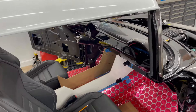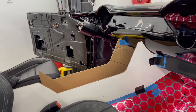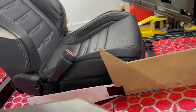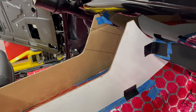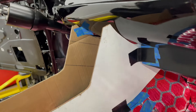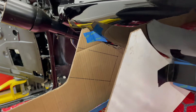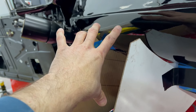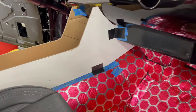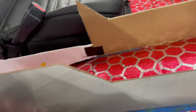Working on the console and getting templates together — started with cardboard and a piece of plastic. This is my first full cutout of the template. I've got a floating double DIN receiver, so I had to measure the angle and all the standoff dimensions carefully to make sure I was good. It's going to sit up high, kind of into the dash, and float with a little adjustment to it. The trick is following the tunnel.